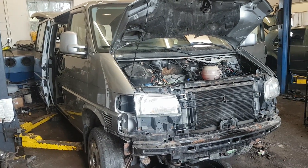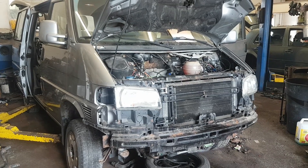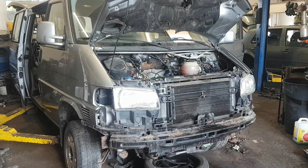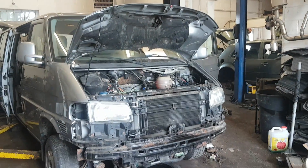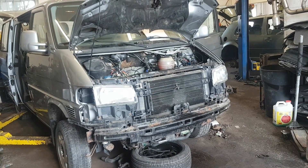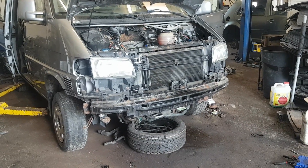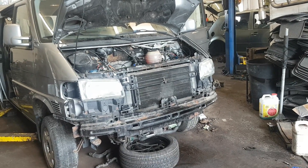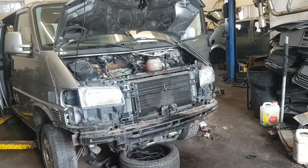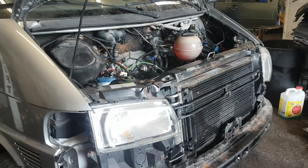It's starting and running. I just have to burp the coolant and bump the injection quantity way down — it's really high right now. It's supposed to be between three and five, but right now it's at like 11. It took quite some time to find all the coolant lines, junctions, and routing because it's kind of unique. It's kind of a mutt of a bunch of stuff — like a puzzle where you have to get the right piece in the right place.